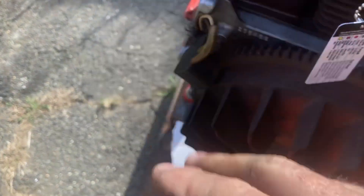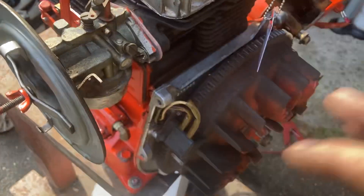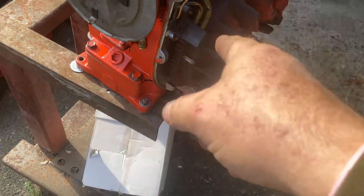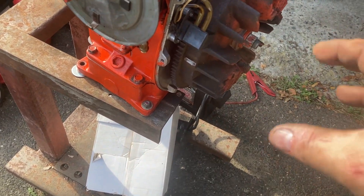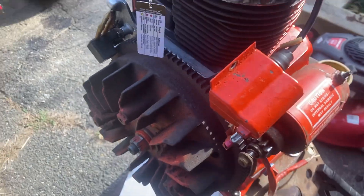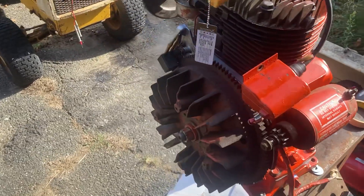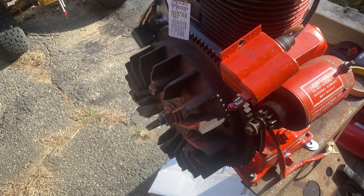This tests good, that tests good. Even the two wires that go to the trigger and back to the ignition switch — no shorts. Everything is good. Nothing's going to ground. The only thing I can think of is something in the stator winding. One of these wires goes to the stator. Is it something in the stator, the magnets in the flywheel, something not going right?